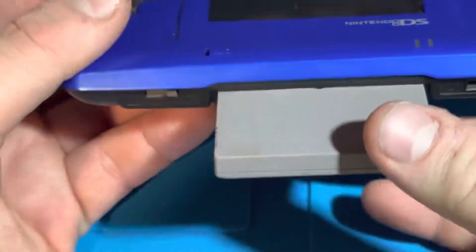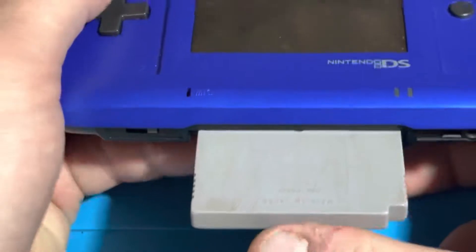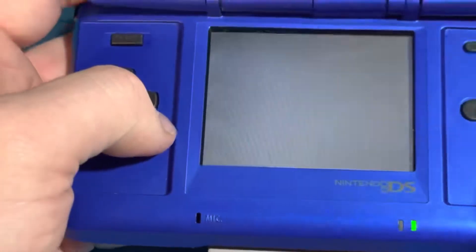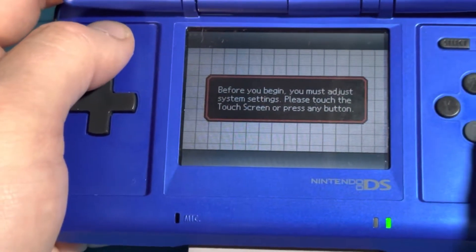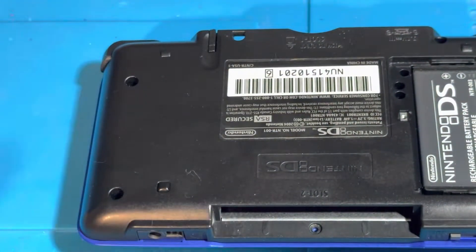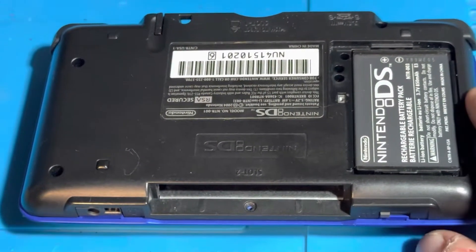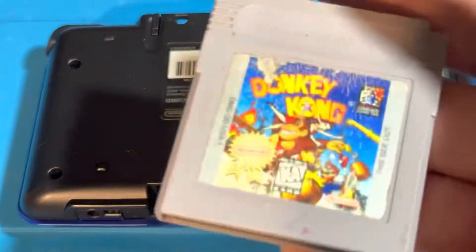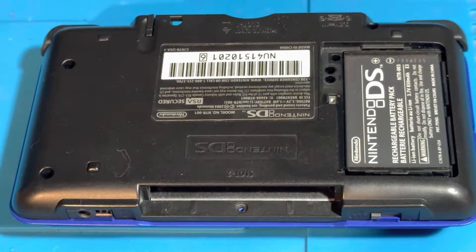As you can see, they fit in there now. However, even though I cut off the notches so that the original Game Boy cartridge can fit in there, as mentioned before, the Nintendo DS, Game Boy Micro, or Nintendo DS Lite do not support backwards compatibility for Game Boy or Game Boy Color cartridges, due to the fact that the processor made for running those games is absent on the motherboard. So I am going to reassemble this DS, and I'll show you what I mean — I'll use a Game Boy Color cartridge and an R4 card to make it look like I'm really running those games on the DS, but it's just a prank.